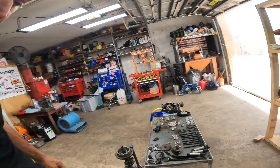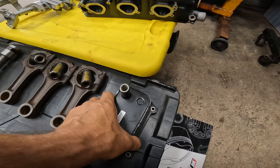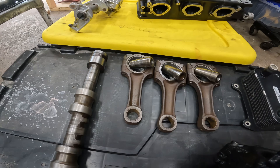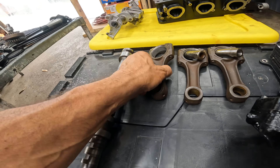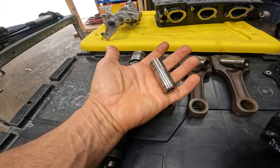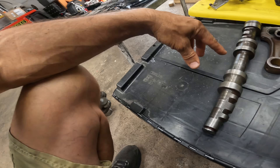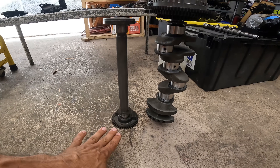The oil cooler — this is an open-loop motor — it's seen better days, I can see corrosion in there. The pistons are gone because this motor originally had water in it, it locked up. He took it apart and the block and pistons were no good, but he only brought me the stuff that was good. The factory rods are completely rusty and completely pitted — I am not using any of this. The cam has an aftermarket cam, it's rusty and pitted. Could you polish it? Probably. Do I want to polish it? No. So I'm just giving him another cam. The crank and counter balancer also need work.